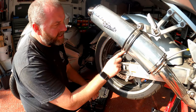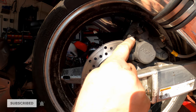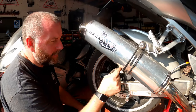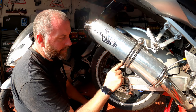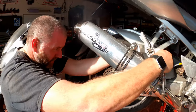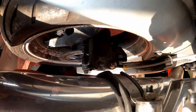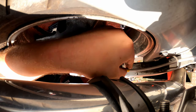Before we start, this little cap here — the pad retaining pin cover — is basically a little cover with a flat head on it. Underneath that there is an allen pin. Whilst it's on the bike, I've cracked that off just to make sure it would actually come undone, because it can be a pig and it's a lot easier while it's on the bike. First thing I'm going to do is undo the banjo for the brake fluid — and obviously I'm going to lose a fair bit of fluid here.